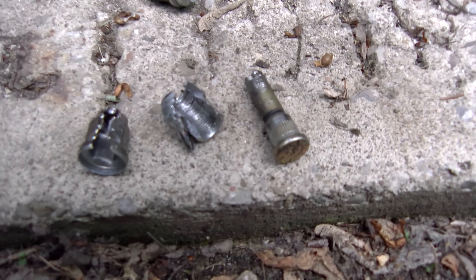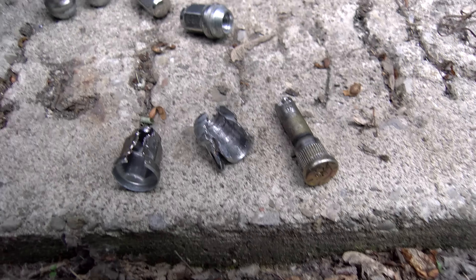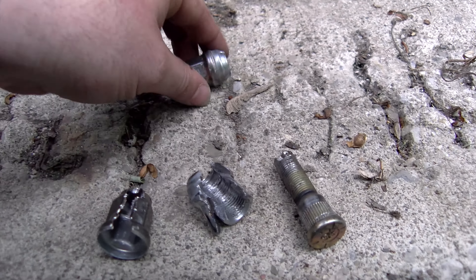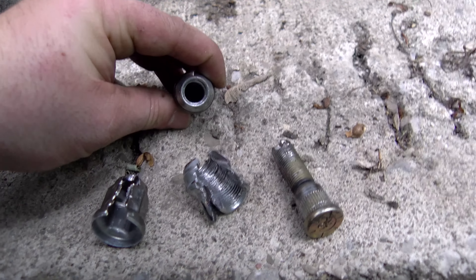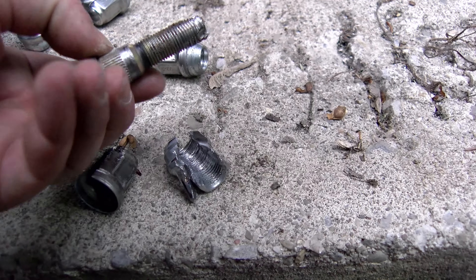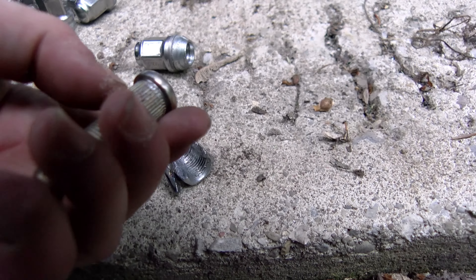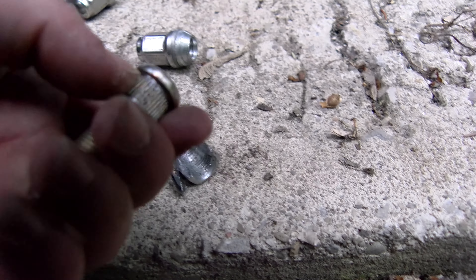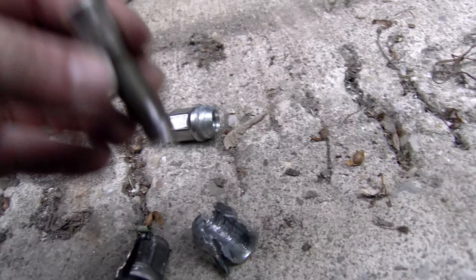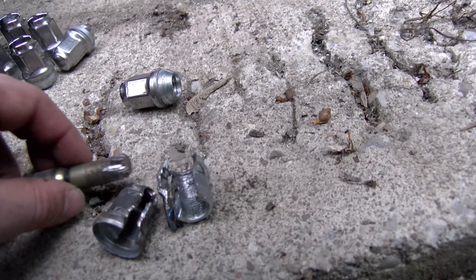So if you're not sure what happened here — we got to the last tire and I noticed one lug nut before it came off really hard. I thought maybe the battery was dying, and I realized the battery was fully charged. Last lug nut I got to — whoever ran this on at the factory stripped it right out. You could see the threads stripped. It was so bad — the spines inside stripped out, and this bolt was just spinning in there. We were able to cut the lug nut off to get it out.